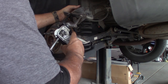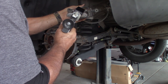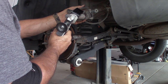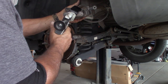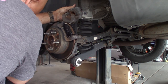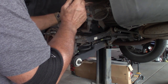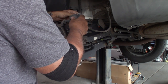Get your brake tool and just press the piston in. If it goes in nice and smoothly, pretty much effortlessly, it's good to go. If you go to press one in and it doesn't want to go — it's hard and you can't force it — crack open the bleeder valve and check it. If it's still hard to go in, you're probably going to have to replace the caliper.